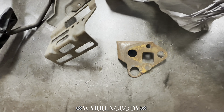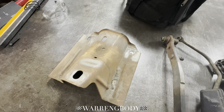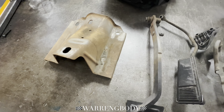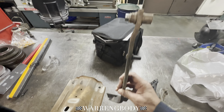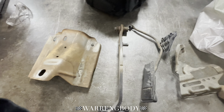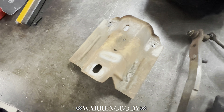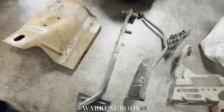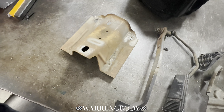I'm up at the workhouse. I brought a few of these pieces in — we're gonna sandblast them. I'm hoping the sandblaster works. I still gotta take the brake booster back off — I completely forgot the bracket that holds the pedal assembly is held on by the bolts that hold the brake booster, so I gotta take that back off. I'll bring it back up here tomorrow. I'm in the area — might as well go ahead and knock it all out. I'll sandblast it and then just primer it and put some roll bar and chassis paint. If it was a high-traffic area, then I would go ahead and powder coat it, but this will work fine.